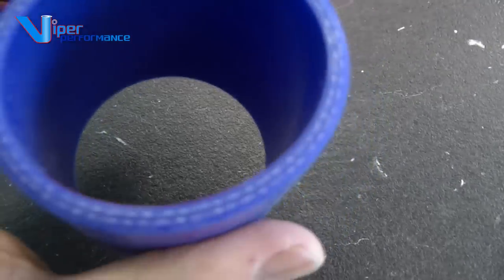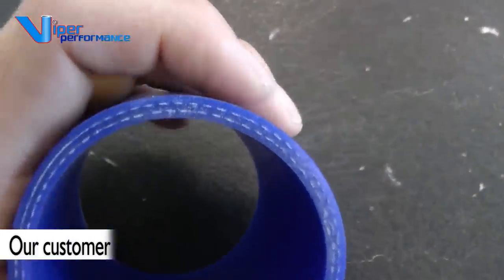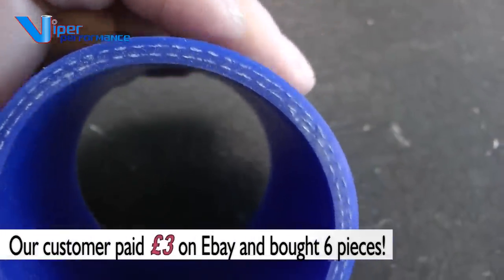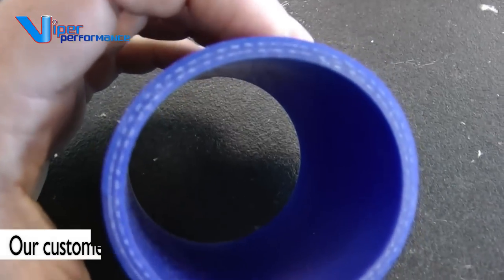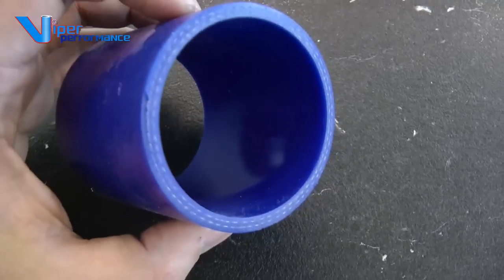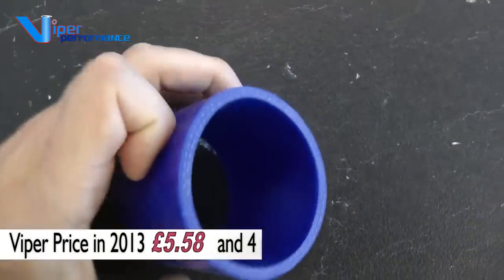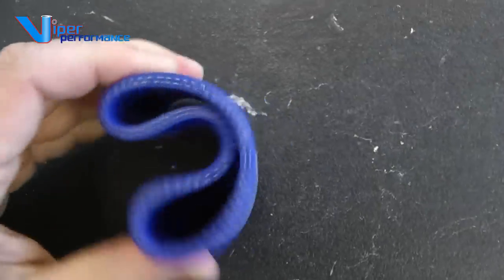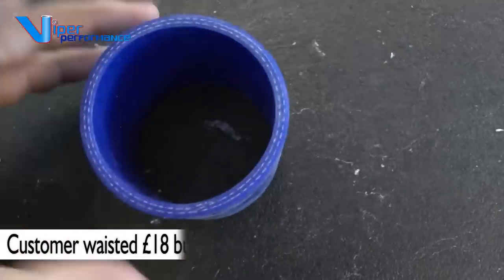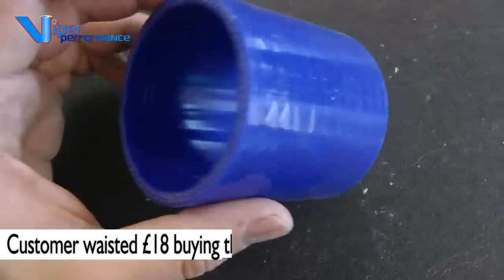The standard on this should be three layers — minimum four is recommended. This is a half-price hose, and quite so: it is half the number of layers that you get on a normal, typical silicone hose, so the performance of this product is very poor. If you put this on an intercooler, this hose is so soft that the slightest bit of pressure going through your intercooler system will cause it to absolutely swell and distort, and it will burst extremely easily. Buy it at half price, buy it twice, buy it three times — waste of money.